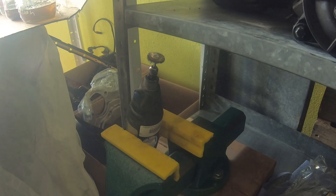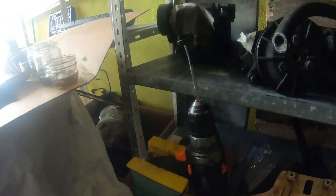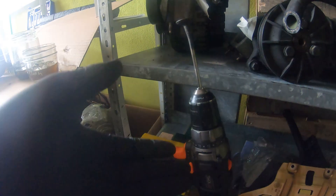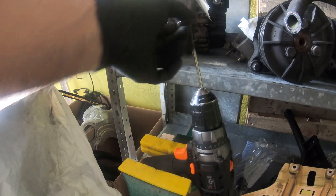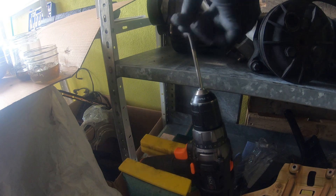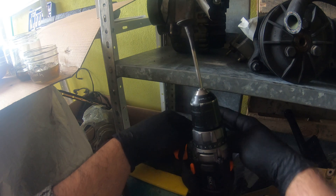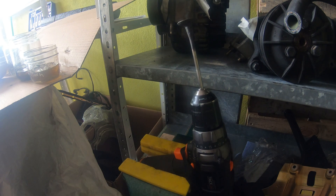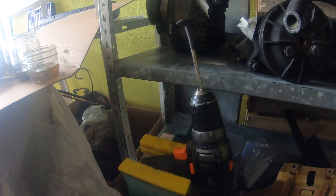Okay, we're going to move to plan B. So I went and got my drill. What we're going to do is run the drill and just sandpaper off this crud here, and maybe the bottom of the valve as well. Then we'll use the Dremel to polish it up, and that valve will be ready. We'll use the valve grinding compound in the actual head to really make it sit nicely. I have some velcro here I'm just going to use. Now a drill should not really be run like this, but just for today, we're going to velcro it like that, or at least try to.